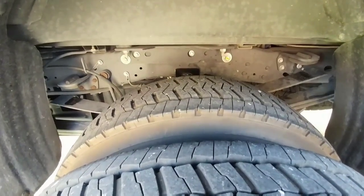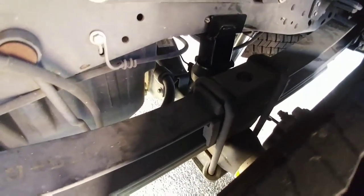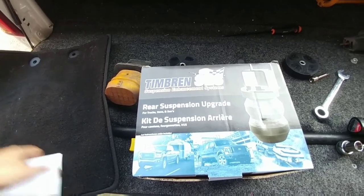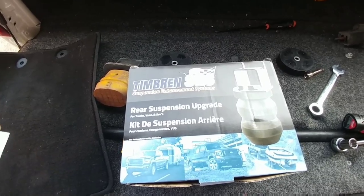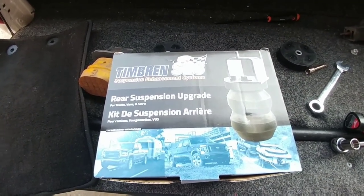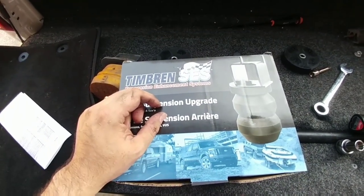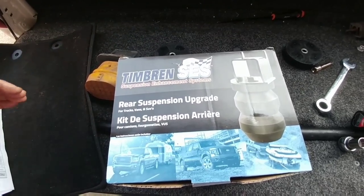And that's it guys. I'll show you what it looks like right here. That wraps it up for the installation of the Timbren SES suspension enhancement system, part number FRSDE. I'm going to mount a camera under there real quick and take a look at it. I don't have a load in the back yet — I will when I haul the fifth wheel — and I'll do another picture so you can see it working. What I want to show you is how it doesn't make contact when you're driving over normal road conditions, because you don't want it constantly acting as a large bushing when you don't have to. Only when you have a lot of weight over the back. That's why you want that half inch to inch and a half of clearance between it and the top of the axle housing.